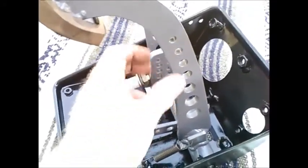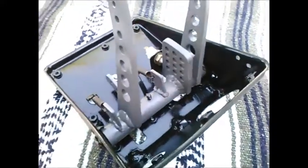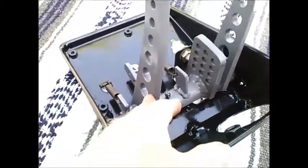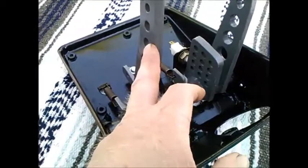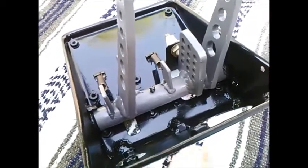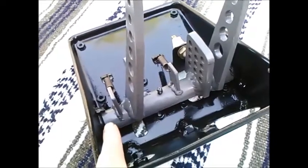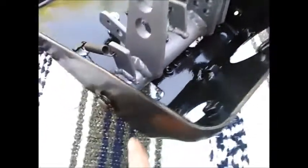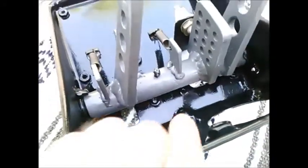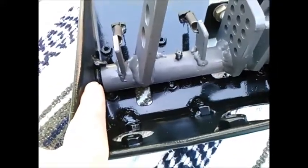I made these pedal arms out of 3/8 steel — the stock seemed to be about a quarter inch. I made sure that even with these holes drilled, at every cross section it's the same area or more as stock. The center support is gone. The shaft rides on bushings at both ends, with the stock pin going up the middle. I put a grease fitting on it and made the initial pumping up with grease.